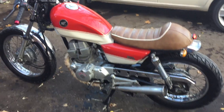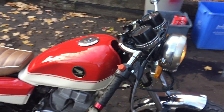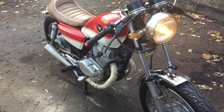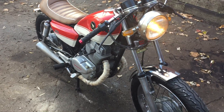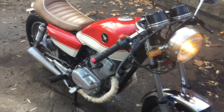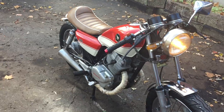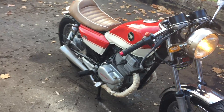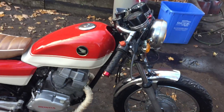The 1982 Honda CM250C is done. A couple tiny little things probably left to do that I can't think of at the moment. I'm going to lower the front end a tiny little bit and reduce the pre-tensioner springs a little bit, because I did lower the forks but the pre-tensioner springs are pretty stiff right now. I've taken it for a ride and it's really, really stiff. So I might take about half an inch out of them. Otherwise, everything's done.